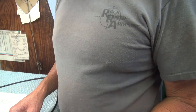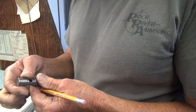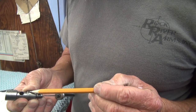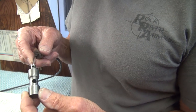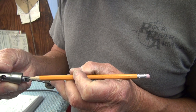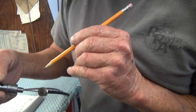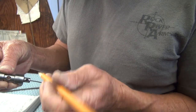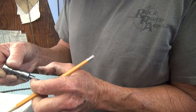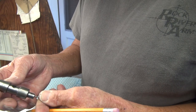Hello again. The project I've given myself today is to start the Mikuni installation on the Sportster using the enclosed throttle cable. But before I do that, I want to make a replacement barrel for the throttle. The reason I'm making it is because the set screw that holds the cable has a blank hole on the other side, which causes the cable to kink when you tighten it down. I want to thread the hole all the way through so I can put a set screw on either side, clamping equally on the cable. That will require a 1/16th inch diameter hole drilled through the body so the cable can slip in.